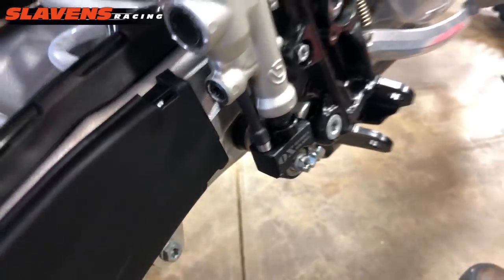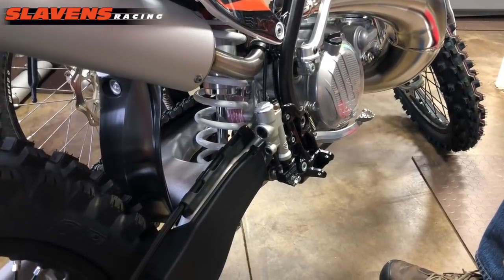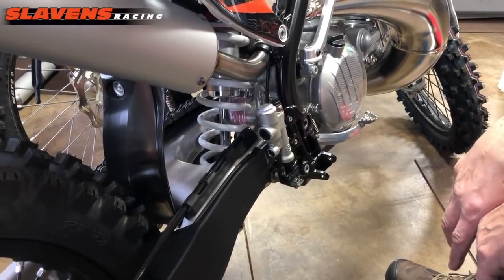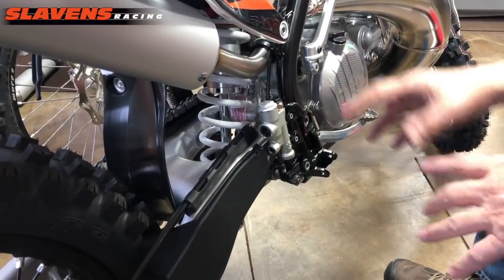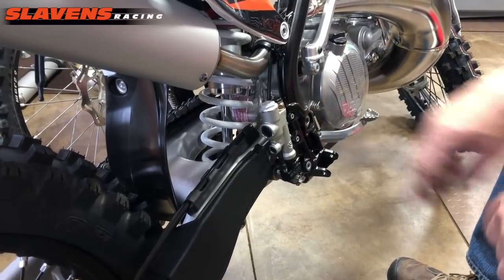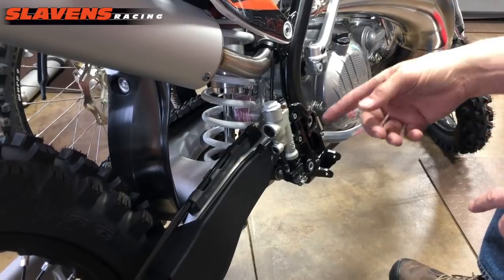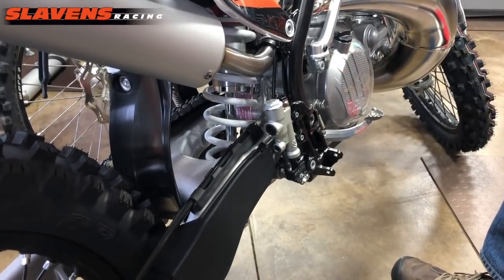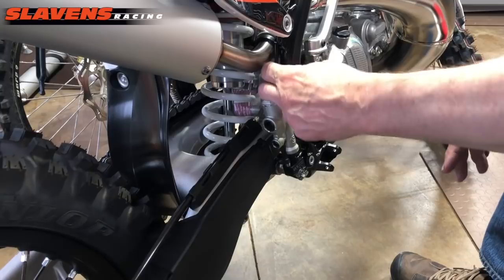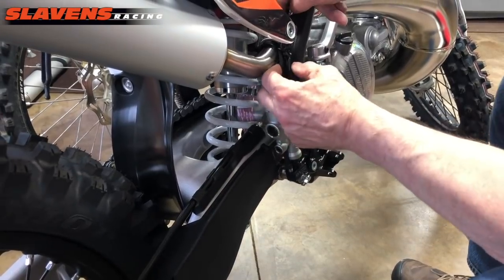It's a totally independent system and easy to install. You can install this thing in 15 minutes. The other kind that we sell are excellent systems also, except they do have a pain in the ass bleeding procedure — this one does not. So the big benefits are: this is an independent system, it has nothing to do with the brake fluid in the OEM master cylinder. You could cut this line with a pair of side cutters and the back brake pedal is still going to work fine. And it's the same price point as the other ones out there on the market, so it's kind of a no-brainer. Just make sure you zip tie these lines so they are not rubbing on the pipe.